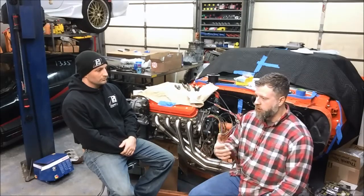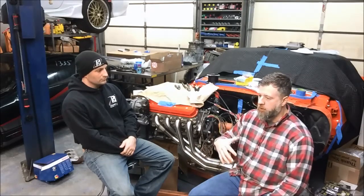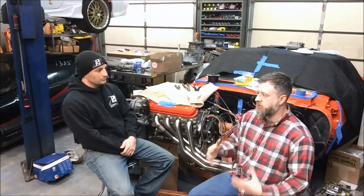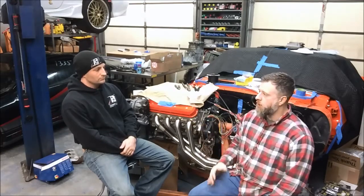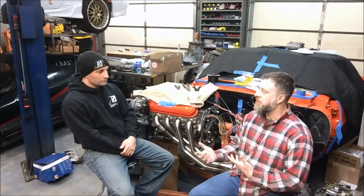Some tuners will argue that it's easier to tune wild cams with the drive-by wire setup, and it is to a certain extent. But for 90% of the guys out there, it's easier with drive-by cable. When I have clients that want to do a build in a 300ZX and they're trying to save money, I tell them: stick with the Gen 3 motor, stick with drive-by cable setup — it makes life easier. That's not to say one is better than the other, but in certain applications, it's certainly easier.